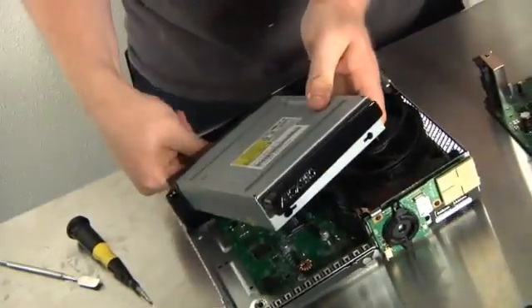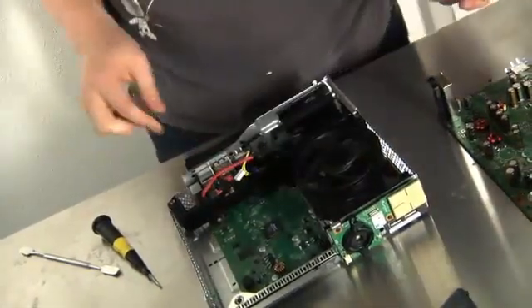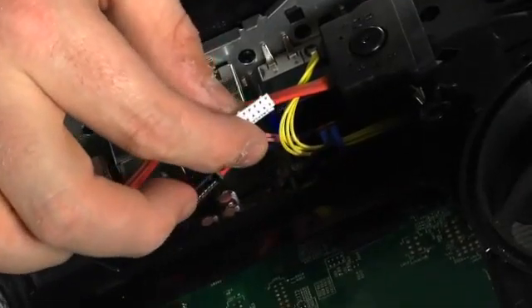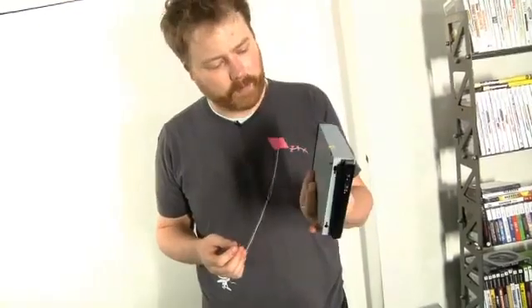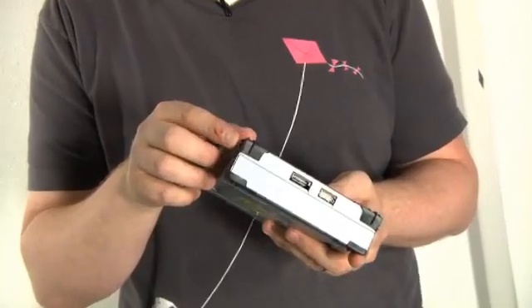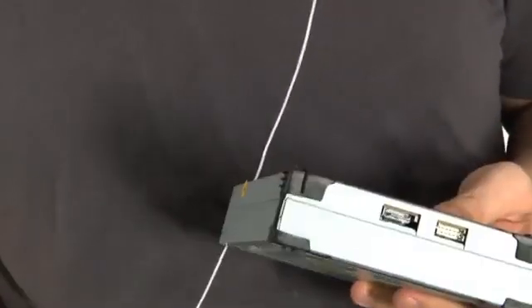I'm popping the cables off the back — it's just a standard SATA connector. And then there's a weird little eight-pin power thing that's different from a normal SATA power connector; I'm sure it's wired the same but just uses a different connector, so you can't just take a normal DVD drive and drop it in and have it work. Interestingly, the back of the drive where it hits the chassis has this rubber gasket around the edge, which should help dampen vibrations — one of the things that makes the 360S a little bit quieter than the original 360.